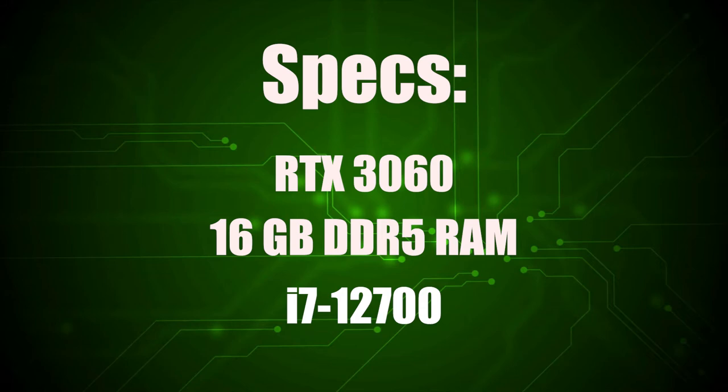This is an i7-12700. It has 20 logical processors — it's a 12-core processor with eight power cores and four efficiency cores, and those power cores are all hyper-threaded, giving you 20 threads in total. There are two slots on this motherboard for NVMes. Currently we have a high-speed Samsung NVMe at 512GB — I believe it's fourth gen, so it's very fast. I'm going to be installing a slower one-terabyte NVMe just for storage of video game files and movies that don't need to be super high speed.